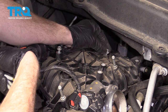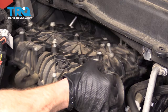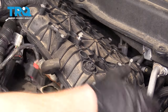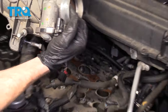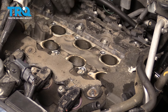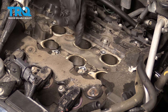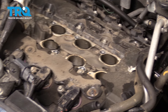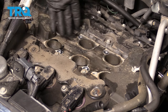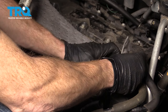You can see that these ones are stuck back here, so we'll just leave those where they are. Now let's move these wires a little bit out of our way and give this a nice little shake. Carefully lift it up. We want to make sure that we don't drop any debris into the engine, because as we lift this up there are going to be some open ports into the engine. Now under this area you can see the gasket — go ahead and set this aside. Looking along here, you can tell that there's a lot of dirt and debris. We need to make sure we get all of this out of here and make sure nothing falls inside any of these ports — that's super important. Use a vacuum cleaner or whatever you've got. Now that we have this fairly cleaned down, let's continue on by covering up those holes so nothing can make its way down while we're doing our job.